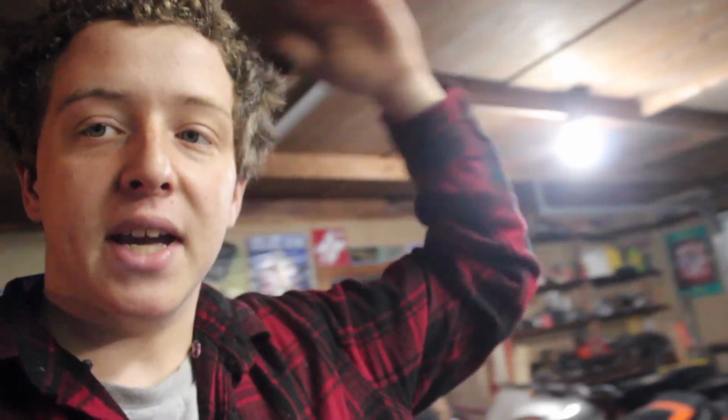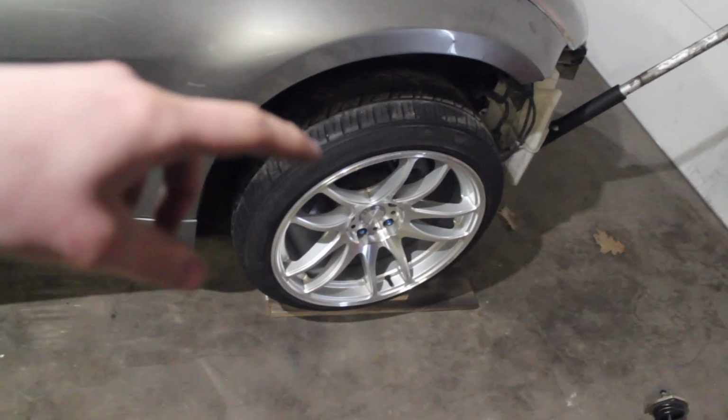And then if we come in the car, I also lowered the back of the seat, because before, how I had the seat mount, my head was literally on the roof, and that was without a helmet. So right now it's sitting a lot lower. I'm gonna start on the front. I'm gonna pull these wheels off, pull the coils out, the lowering springs, remove the bump stops, and throw the coils in. So I guess the strut bar has to come out.